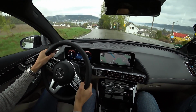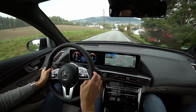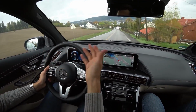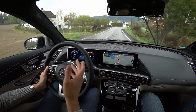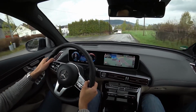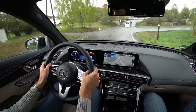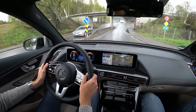And it's very important here for electric vehicles to talk about the recuperation, to gain back the energy. And there's this auto mode, so the car decides itself, also according to GPS data, for example, and what's coming ahead. It's very interesting. Usually you can leave it like this. So at the moment, for example, we're going downhill, but the car is maybe not decelerating enough, and then I can set the left shifting pedal, put it to D minus minus, and you can see I now have to accelerate again to even it out.